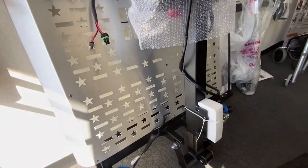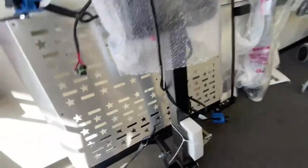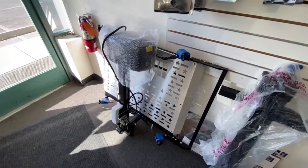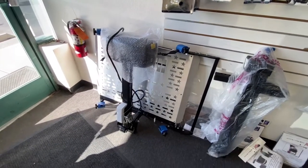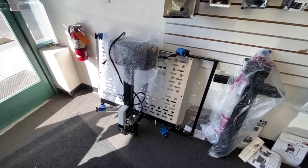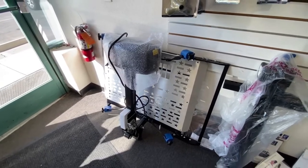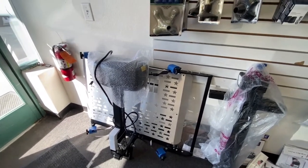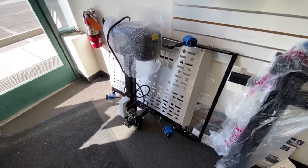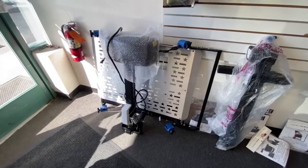The customer who ordered this actually has a Golden Light Rider. With that scooter, the footboard is not really supported by much frame, so the lockdown foot would actually damage the plastic foot shroud. You can't use the automatic lockdown on that scooter, and hence why you have to use the AL300 and secure the scooter with the easy ratchet straps. Unfortunately, that's all they could get — the AL300. So it will be ready to install when the customer gets here.